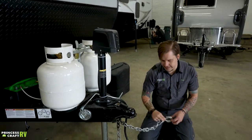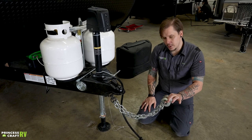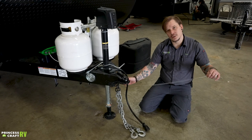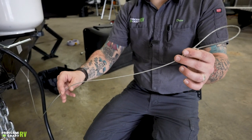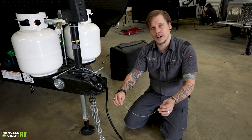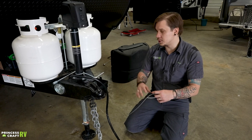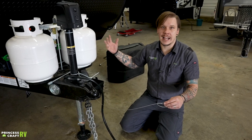From there we take our tow chains, cross those underneath the coupler, and hook them to the receiver of the vehicle. Make sure you have enough room to make turns left or right, but not so much that they may contact the pavement. Also very important: riding right next to those tow chains is your emergency breakaway cable. It is very important that you use a third or separate connection point on the receiver — whether that's a quick link, a carabiner, whatever — attach this separately. If the other tow components become compromised and the vehicle starts to separate, this acts like a ripcord to the electric brakes to stop the unit.